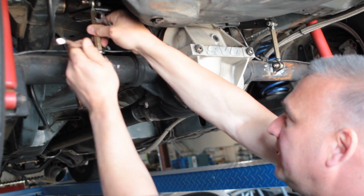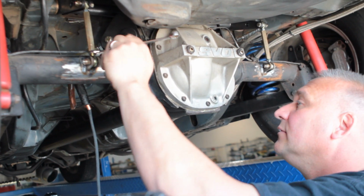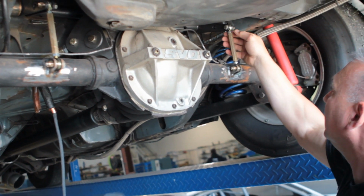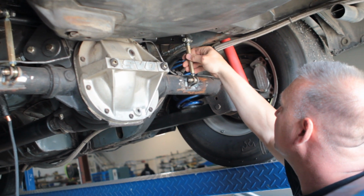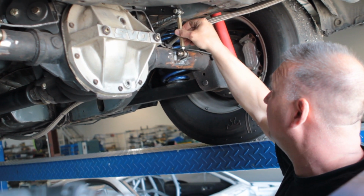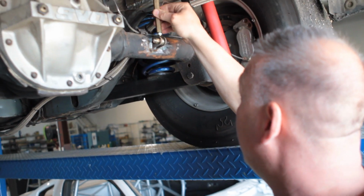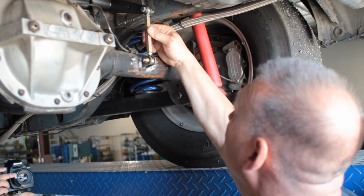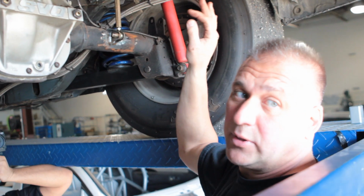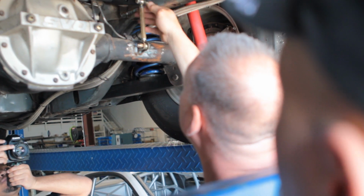I see where that hex dot comes in handy now. Yes. This one's a little bit off. It's a little bit bigger than the 9/16, but you lock the jam nuts down on that. Now, you take the passenger side, and you want to lengthen the passenger downlink until you feel resistance between your finger and thumb. It's taking all the slop out of it. And then you just give it 1/4 turn, which is 2 flats. And that adds about 15 pounds of preload to the right rear. No way. And then lock down the jam nuts. And then it's set.